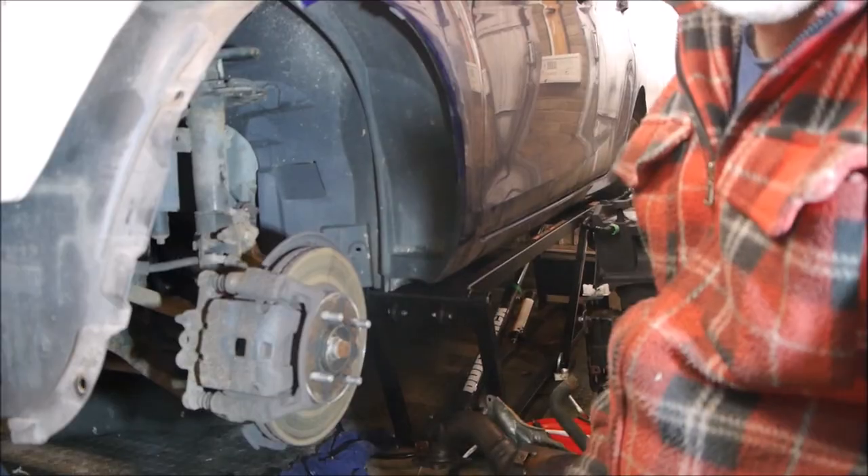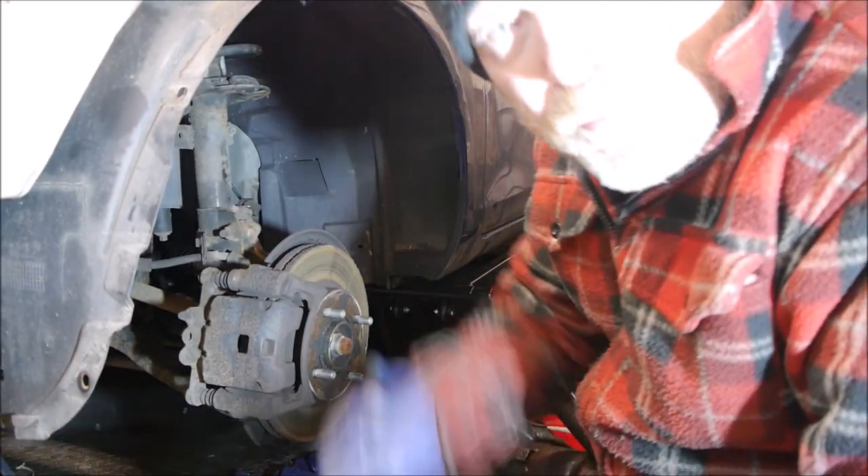Before I show you how to do that, this is probably one of the easiest cars I've ever changed brake discs and pads on. Once you've got the wheel off, you need a 12mm spanner and a 15mm spanner — and that is it. That's all you need. Ford have made this really easy, unlike the engine which is impossible to get out.